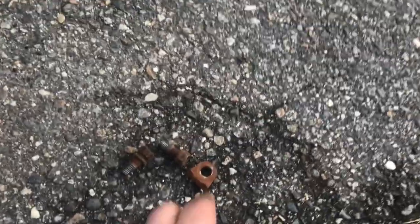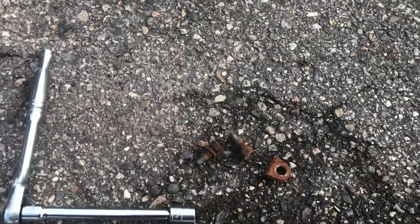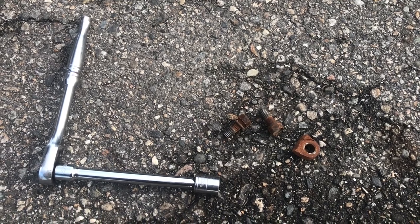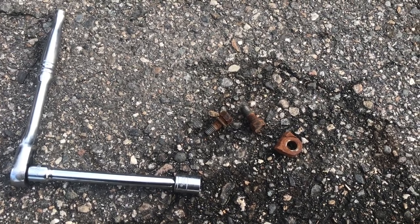One of the parts it bolted onto — if this was the transmission, the clutch slave was sitting down here. It's as if it's not pushing in enough to release the clutch and get it into gear. But even with the truck off, I go to put it in reverse and it's still not really liking it. So I figured I'll drain the fluid, put a new clutch slave, and we'll see what happens.